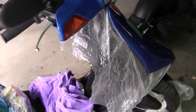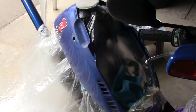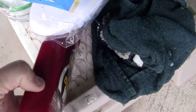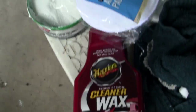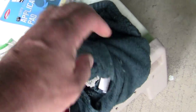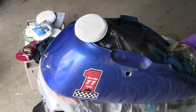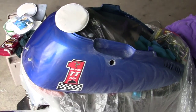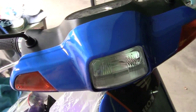On this front here, I've used the wax and also a cleaner wax — this cleaner wax is the next step, it's just a finer polish. I got a crack in it so I've got to leave it there. I used a different pad and I've used the cleaner wax, and I've washed off all the grit from the heavier polishing compound. The cleaner wax is basically a little bit of wax with finer sand in it.